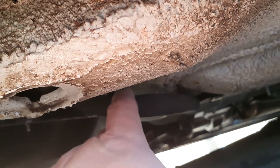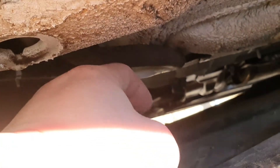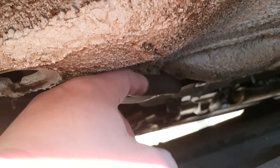There's a bit of insulation on the black one, but it's not enough, and that's causing the vibration. When you rev it halfway, this vibrates a bit and the vibration touches the undertray and makes that noise.